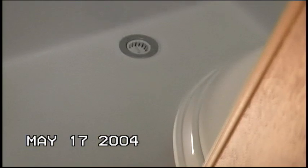What if you're using it in the wintertime, what would you do? Just not use the water part of it? If you were going to go camping somewhere and needed to use it? Well, if I was you, I would shut these off for the outside shower. You wouldn't want that on. And just open your valves, make sure all the water's out. As long as you got heat in here, you can use water in there. In the campground you can put water in it and then drain it before you leave to go home. But don't use the outside water in the winter. If you got hot water in your hot water heater, it keeps it warm in there anyhow. When the temperature goes down, she'll kick on automatically.